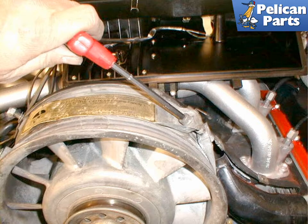The alternator is attached to the fan and the fan housing. The housing is strapped to the engine case using a long metal strip that needs to be loosened and disconnected before the housing can be removed. Remove the coil and the few select screws that attach the fiberglass engine shroud to the fan assembly. The long metal strap does not need to be completely disconnected from the case — leave it attached to the case at the bottom.